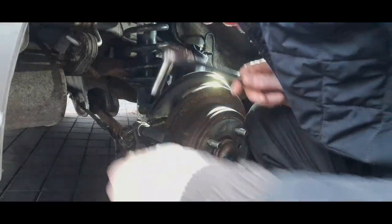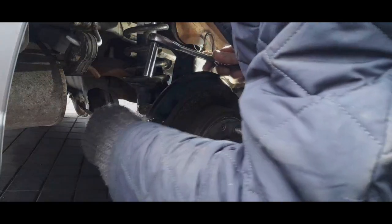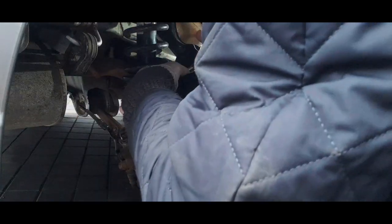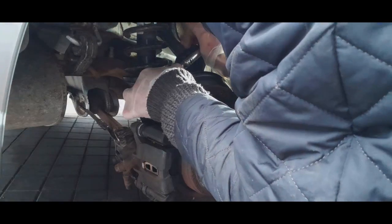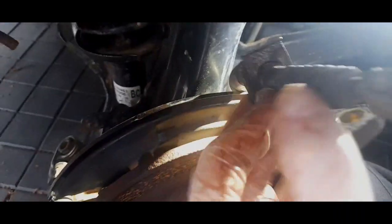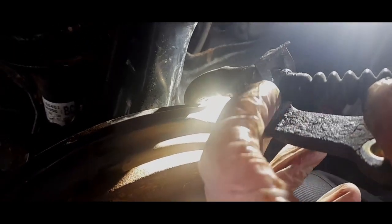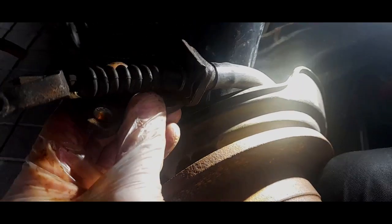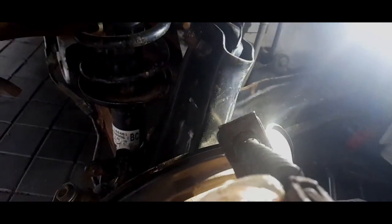They are two 12-millimetre bolts, just take them out. There we go - that was a lot easier. All I've done is got a screwdriver and just literally pried up and it's moved. We're going to take it completely out, put a screwdriver through, flick it out, and then the hose will come straight out of the bracket. I think this is how they designed it to be done, because there's no way you could do this with it attached to the actual caliper.